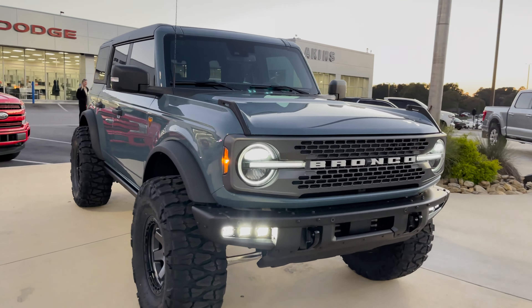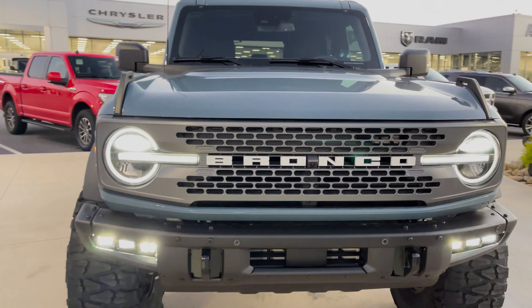So essentially this is a pretty basic build. We did not do any paint work on this one, but a three-inch coilover lift kit that comes with a rear track bar, upper control arms, and a speedometer calibrator. 37x13.5x17 mud grapplers — yes, the mud grappler with the muds on it — because that's one of the most gnarly tires out there as far as overall looks and performance. It's a great tire; it will give you some pretty decent mileage too if you keep it rotated. And then the fuel block wheel, Rigid fire kit lights — a complete Apex build, but a basic one. It's not overdone with paint work. Some paint work would allow you to do a different wheel choice, but a black wheel or this gray wheel to me is almost a must given we didn't do any paint work at all.